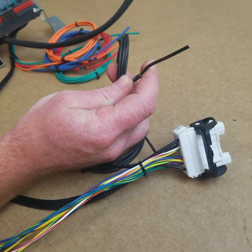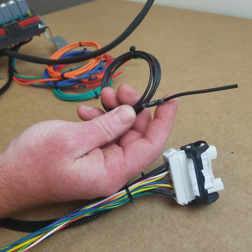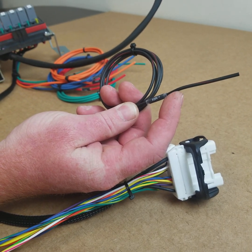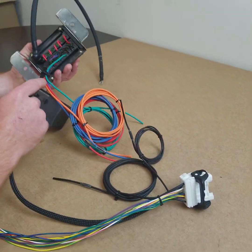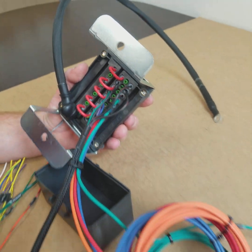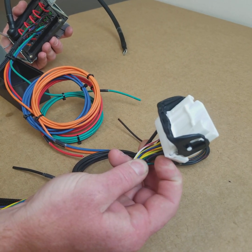To do that, you're going to want to hook this wire up — this is your ignition positive. It's going to come from the key switch inside the vehicle, and it has to have 12 volts while the key is on and also while it's cranking the starter. That relay in the back feeds a second wire which ends up at the corner of your interface to give your engine harness power.